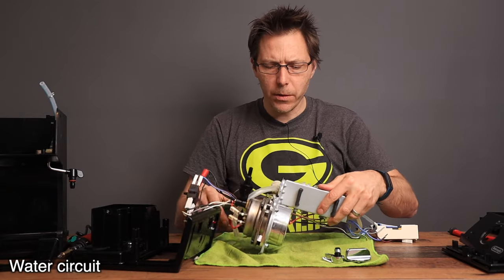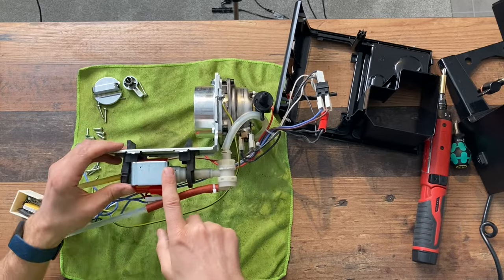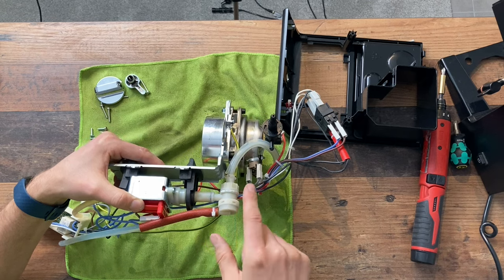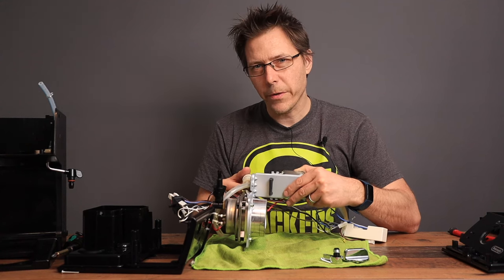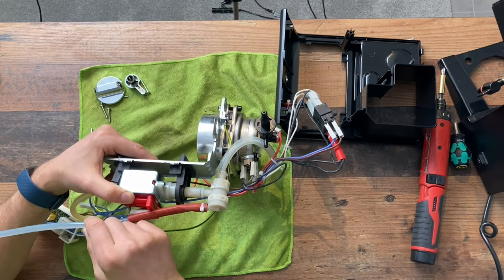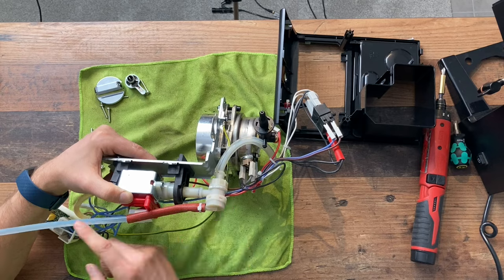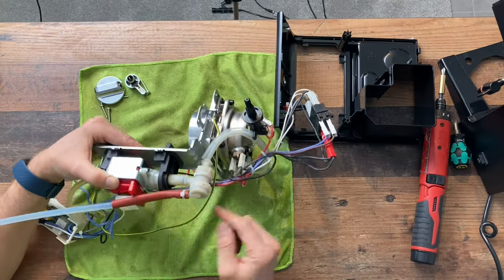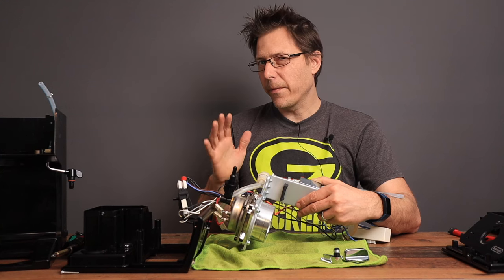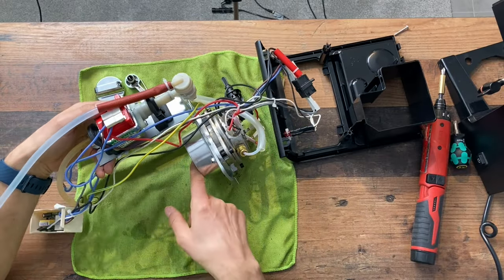Water gets sucked up from the pump, and on top of the pump there is an overpressure valve mounted at 90 degrees — DeLonghi also calls this an anti-drip or safety valve. Normally water doesn't go back into the tank, but if it's broken you'll see bubbles in the tank. The water that makes it through gets pressurized up to a maximum of about 11 bar, depending on the resistance at the bottom of the brew group.